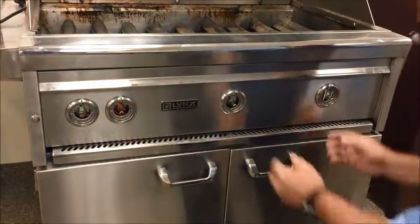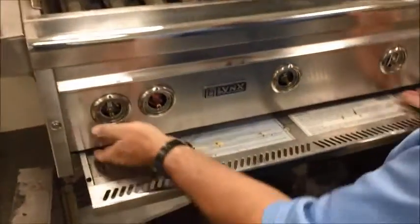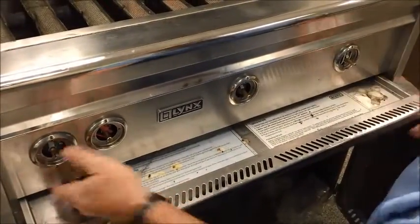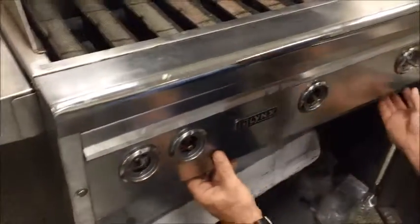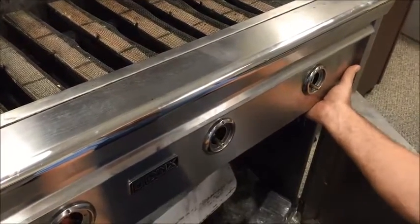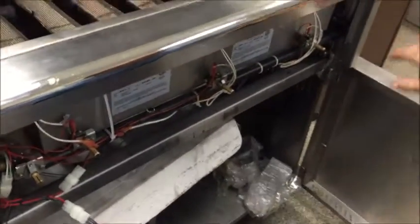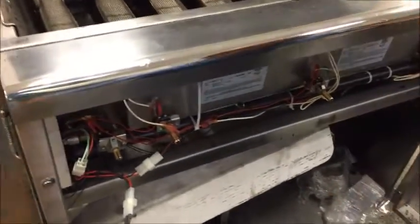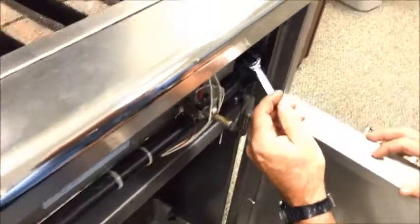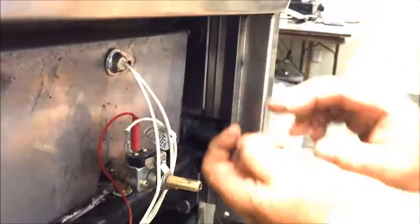Take off the front panel. If it's a car model, you got to open that up — you got the pins here, you slide to the center. Take this out and slide the little pin to release the bottom, then lift up and set it down. You'll need a 7/16 short stubby wrench like this so you can get into the bolt right here. Loosen that up just like so.